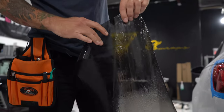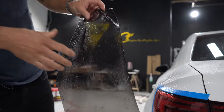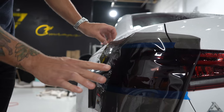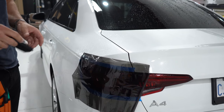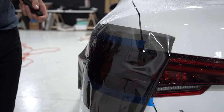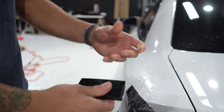That's the fun part about wet tint — we're going to make a mess, but we do get a different result in the end. Not always possible to tint all lights with a wet application film; some are going to be extremely difficult. We also need a rubber squeegee — I forgot to mention that. A rubber squeegee is going to be a little bit softer so we don't damage the film. I prefer this one because it's a bit more rigid and doesn't flex as much.